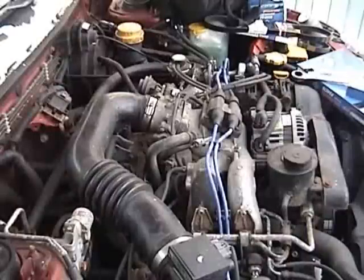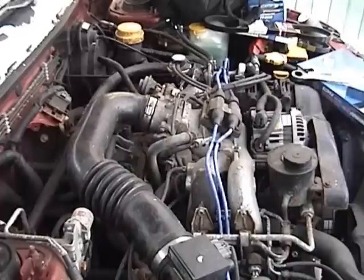Sunday, February 10, 2013. This is Mercedes Diesel Guy, and this is my 1995 Subaru Legacy L Outback. Right now I'm going to do the PCV valve, because that is a general maintenance item. I don't know for sure if the old one is bad or not, but the new one is cheap, and it's a very easy item to replace.